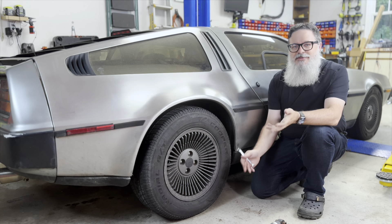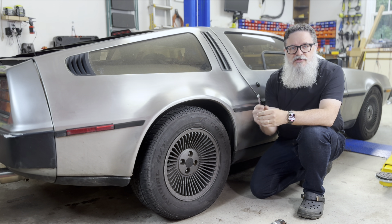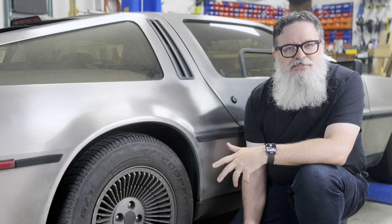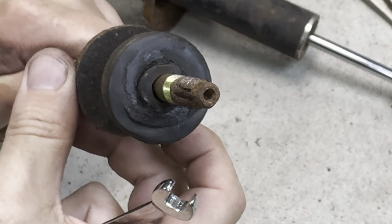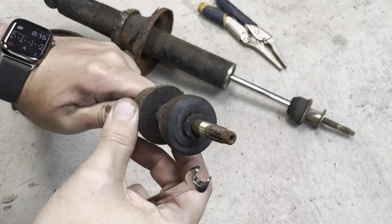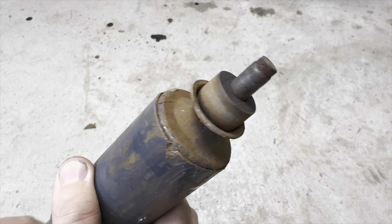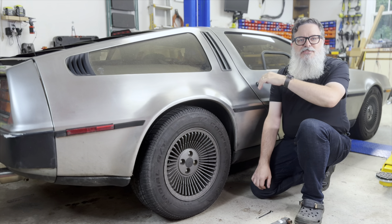A few people commented on my suspension videos that you can put a wrench on top of the shock stem to hold it in place while loosening the nuts — you can even buy special sockets for this. The top of the KW shock stem is a truncated hex, and an 8mm box wrench fits right on it. The old shocks have a hole in the top for an Allen wrench, though it's too rusted for my wrenches. But an open wrench or vice grips would have worked. The point is, I probably didn't have to cut off any of those nuts. Oh well — at least I know for next time, which was this time. Thanks to everyone who let me know.